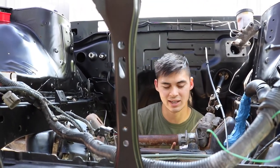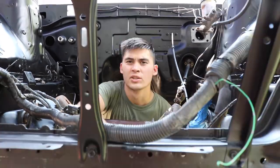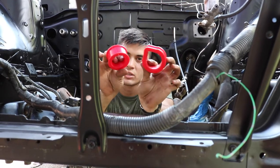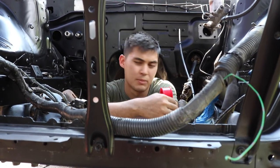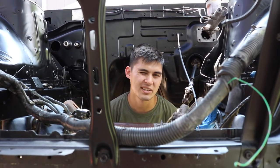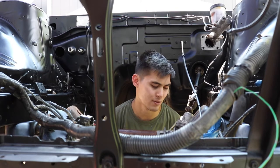You could go way more in depth with cleaning using a wire brush and whatnot - I'm just using a rag to get any big particles out. With the Energy Suspension steering rack bushing kit you actually get three pieces: two of these circular pieces and then one teardrop-shaped one. You only need the two circular ones - they come with an extra because it's kind of a universal kit that also applies to the 300ZX and maybe a few other chassis. I've heard it's a good idea to put some grease on here, but I'm going to skip that step - if it bites me I'll hear some squeaking and reinstall with grease.